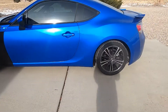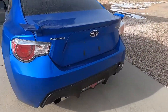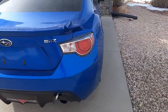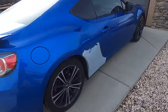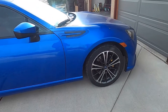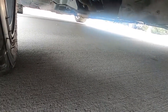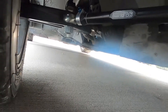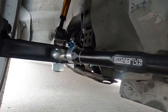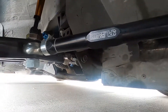Today we're going to show you how to install the lower control arms on the front of the BRZ. We had to do this because we upgraded to the AP brakes and the existing stock control arm is actually hitting the back of the rotor. I only saw that people with aftermarket ball joints had this issue, but I guess it can happen with stock ones too. We also wanted the extra camber adjustment, so we decided to install these SPL control arms, which are pretty nice.